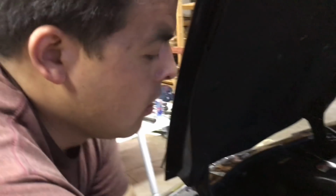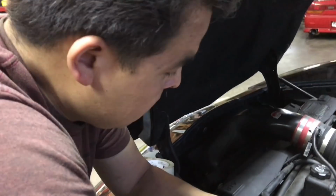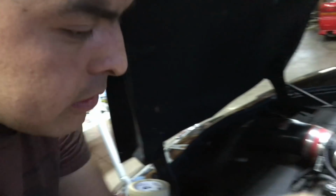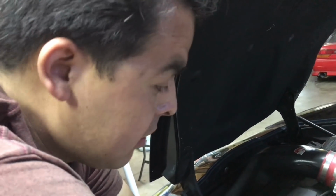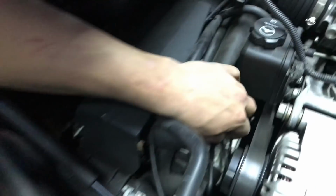Okay, keep talking. Where are those brake lines going to? We have brake lines sitting right here. Yep, I assume they're coming through, there's two of them. Where are they gonna go? They're gonna go down into a T-block, and then that T-block is gonna go down to the rear lines for the rear brake calipers, and the front, and then they go forward up here to your brake module.